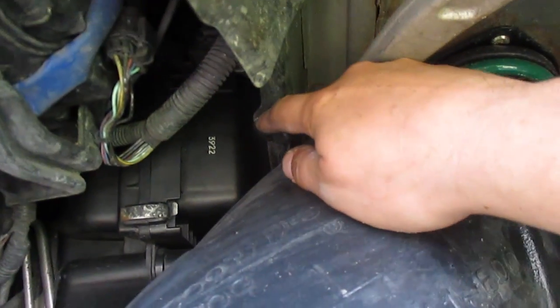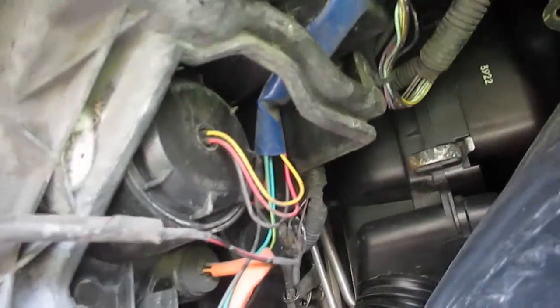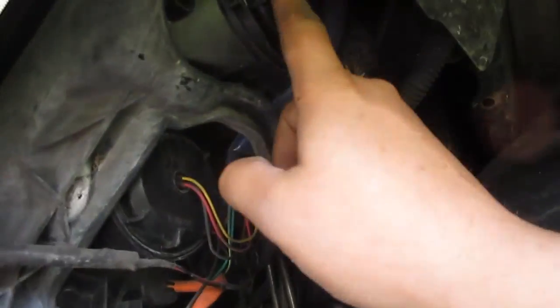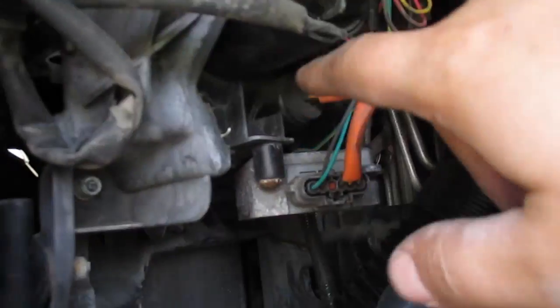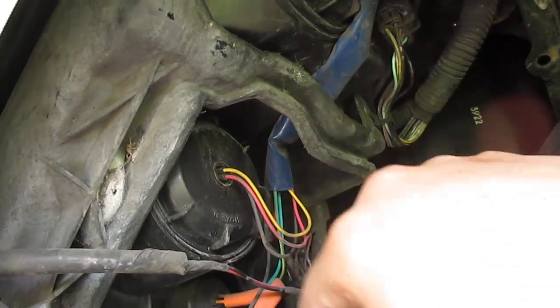What I'm going to do is put the camera down, remove all of these parts, and show you guys how to put in light bulbs. I did end up having to remove the little plastic plug up here. Once you get all those out you're going to pull the fender liner down — it tucks itself inside and there's a little flap you got to pull out. Once you get to this point you're going to see inside pretty much all your lights and blinkers. It's kind of crazy that Nissan makes you do all this just to change the bulbs.